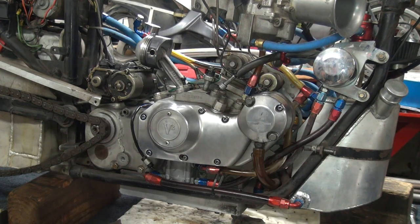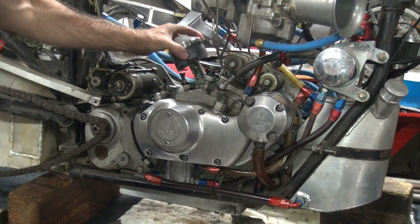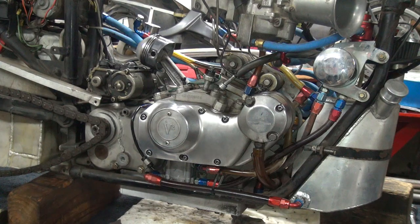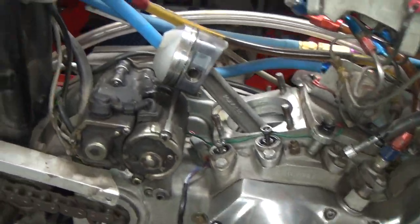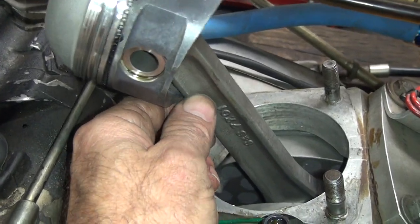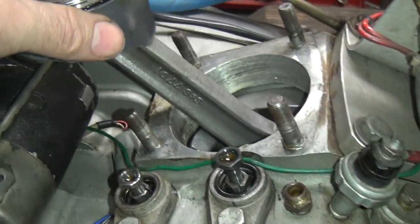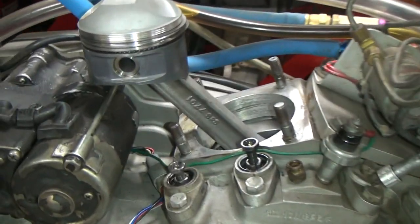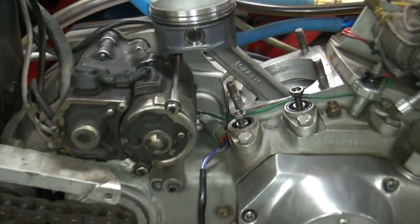So, minor slowdown there — all that because the crank wouldn't turn over. Normally it comes over like this real easy, and that's what it wasn't doing. So I'm going to go ahead and work on the rest of this now. I'm going to go check out my piston here a little bit — see what kind of clearances I run. It's only a little loose. If you run 8,000 RPM for a couple miles straight, you better have it like that or it'll have problems. Found that out after about five years. Anyway, that's how you set them up for a full race. I'm going to go see what my cylinder looks like and move on from there.